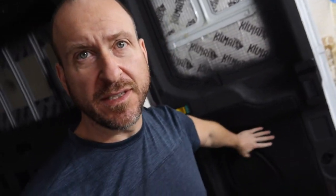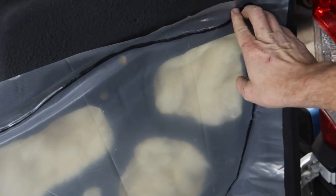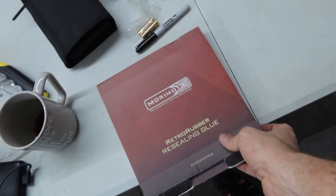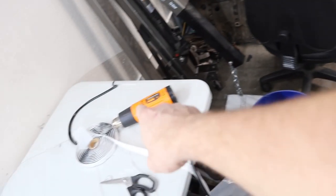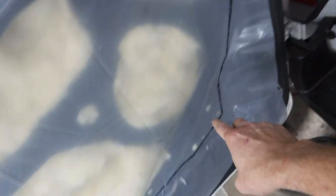The next phase is planning all the panels. I fixed the passenger side rear door because it had that plastic sheeting protectant gasket, but the driver's side was missing. I found how to recreate this gasket — it's a sort of special gooey material. Ninja lent me some; it's called retro rubber resealing glue. The trick is you put it on the surface, stretch it out, then take a heat gun to activate it, then cut a piece of plastic oversized and trim off the edges.